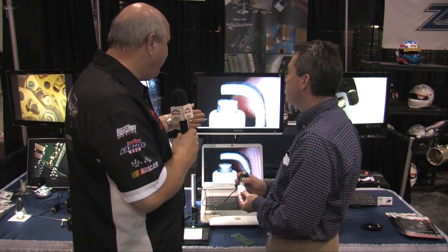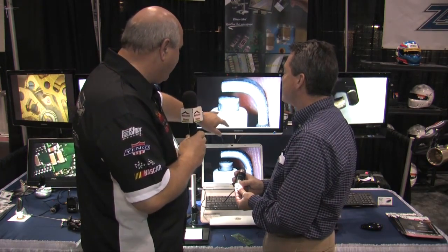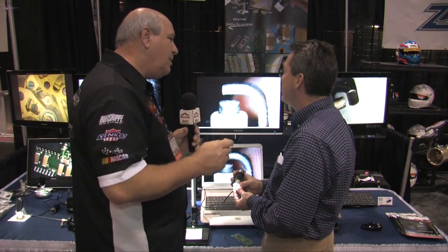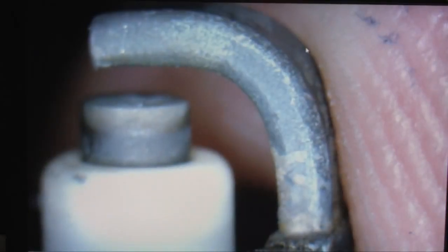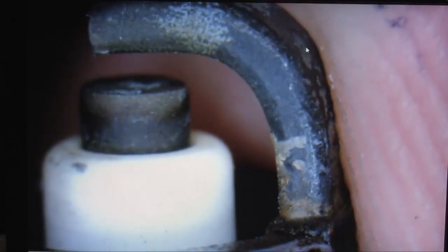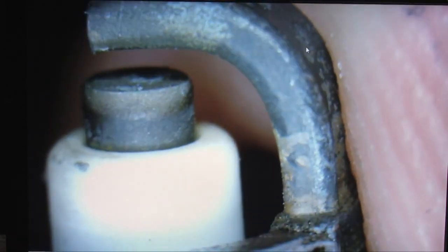We're examining a spark plug here — I've never seen one so large. From a spark plug you can really tell what's going on inside your engine. This is an example of where polarization comes in handy. This is a non-polarized image and you'll see quite a bit of glare. If I wanted to read the heat signature on the ground strap, it makes it easier if I polarize it — and now you can see some definite areas of heat concentration.